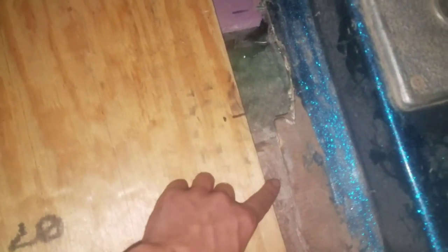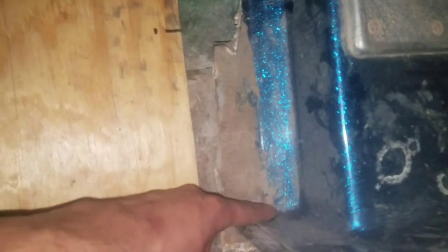Here in the middle is where the floor drain is in between those ribs. I'm gonna go ahead and keep the original floor drain for extra ventilation and in case it helps with drainage if I ever take water over the top or even just someone standing there dripping — I'll have somewhere for it to go. Since the original deck was half inch and this is three quarter, it sits up a little bit higher, and I'm worried about water collecting right here because it won't have anywhere else to go unless I put tiny holes there or something.